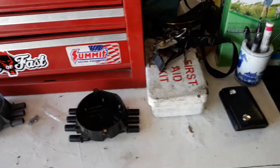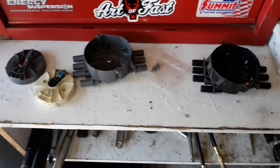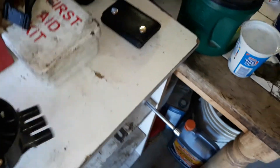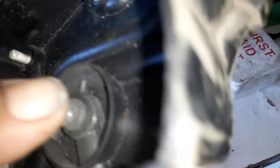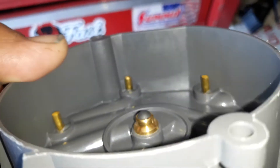This is the conclusion video, number eight. We just got back from picking up Rosemary's parts. I want to show you the difference between the old stuff and the new stuff. You can see plenty of corrosion on the electrode tips, and this one in the middle is flat — see how flat that is compared to this one, which is round like a marble.